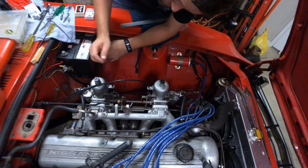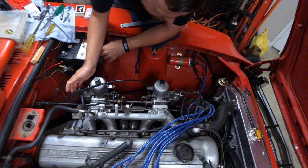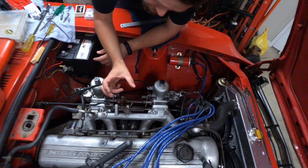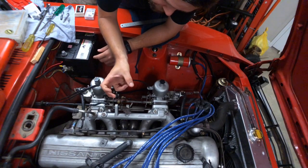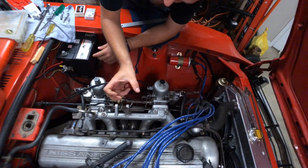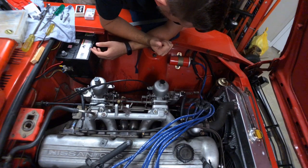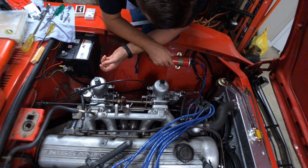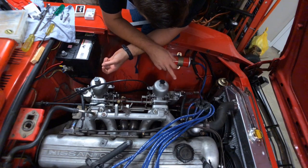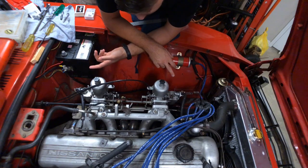I spent a bit of time adjusting these floats. The back bowl took quite a bit of effort because I couldn't get the float perfectly vertical — it kept getting stuck in the bowl and filling up the fuel bowl almost to full because it must have lifted up and jammed, not closing off the valve. They're both set now. I just went with 13 and a half on front and back. That's not exactly the factory spec, but it's a little bit less, which means I'm heading towards a leaner condition — which is what I'm after. So that's all done.